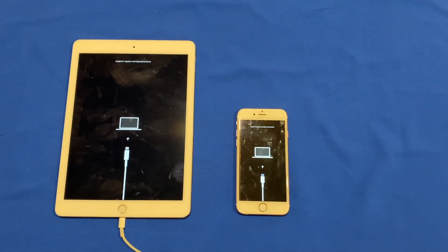That's all there is to putting your iPhone or iPad into recovery mode. This will allow you to restore it to factory settings or do a software update if it isn't working correctly. It's also worth noting that if you need to leave recovery mode manually, just hold down the power sleep/wake button on the side or top of the device and it will reboot back into normal iOS. If you haven't made any adjustments — like restoring to factory settings — it should have all your data still there, so you shouldn't lose any data in this process unless you reset it with your Mac or PC.